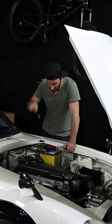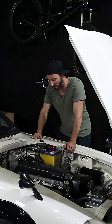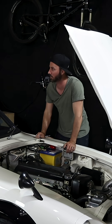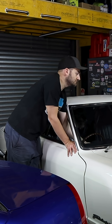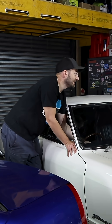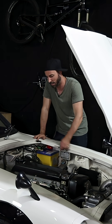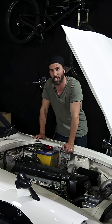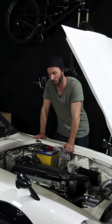That's like the simplest mod ever, and also super handy if you're parking your car up for a while and you don't have a trickle charger. I didn't even know that product existed until we started investigating this. To check that it works, we do some horn — and then if I turn off the tap, turn the tap on again. It's worth noting that if you are turning this off, it means your alarm, immobiliser, tracking, and any other stuff you're running is not going to be working anymore unless it's got its own power source.